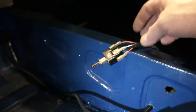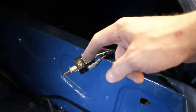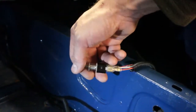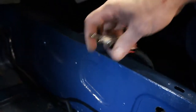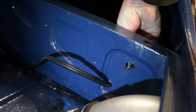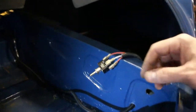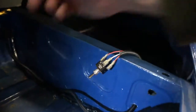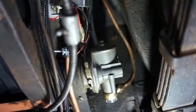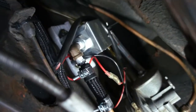I'm wiring up the three-way toggle switch — I get the input from the vehicle and then the two outputs wire to this three-way switch. I'm just gonna mount it right here in the back, poke it through the hole, put the cover on, zip-tie this down to the other wire loom, and we'll be all done.